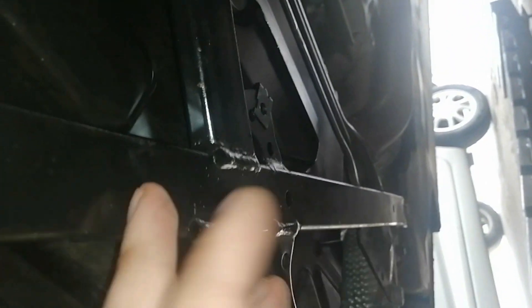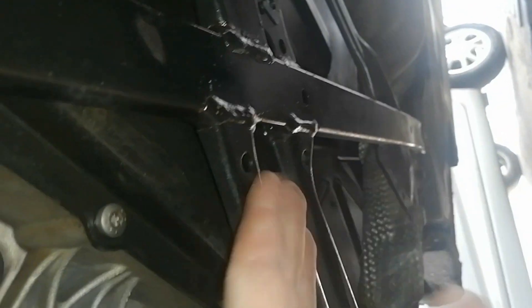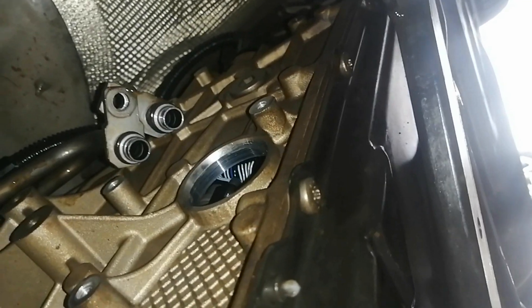Right next to it there's a big black metal piece - that's just for protection so anything on the bottom of the road heating up won't heat your gearbox oil sump. Right over there is the drain plug. Here is your oil filter housing, and there is your drain plug. I doubted there'd be much oil coming out, and there was just a little bit - I moved my drum a bit too late, so a small amount went on the floor.